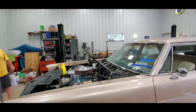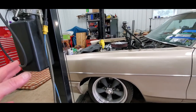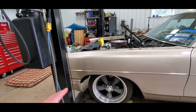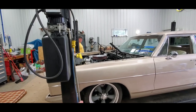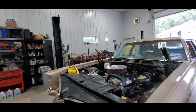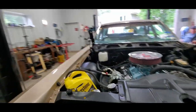All right, at this point, there's a few things. One, when you hit the brake, if the car's moving, this caliper moves and sometimes doesn't seem to release. That could be a few things. We're super curious, since we didn't check, if the previous owners, when they put those adapter brackets in, actually tightened them correctly, since every other thing in this car was loose. So we're going to check those. We're going to check and make sure that the hoses aren't blocked or collapsed, because even though they're new, that doesn't mean they're good. There's definitely a return issue. We're curious if the issue is in the booster, the master, or this brake. So we're figuring out how we're going to troubleshoot that without spending a bunch of money first.